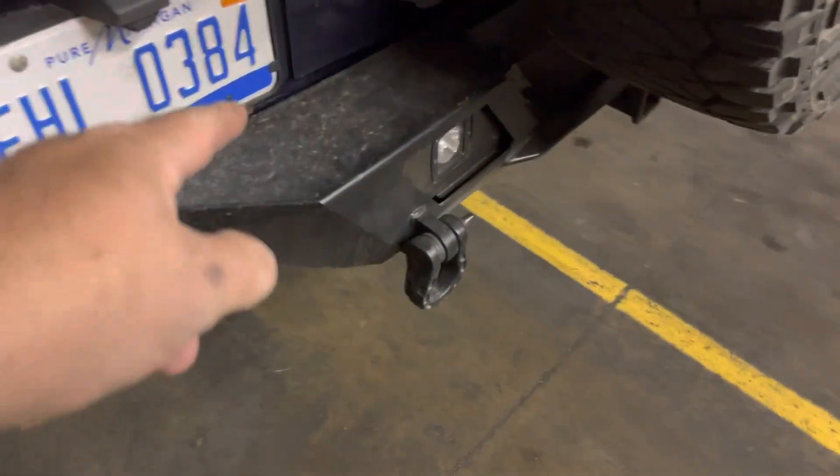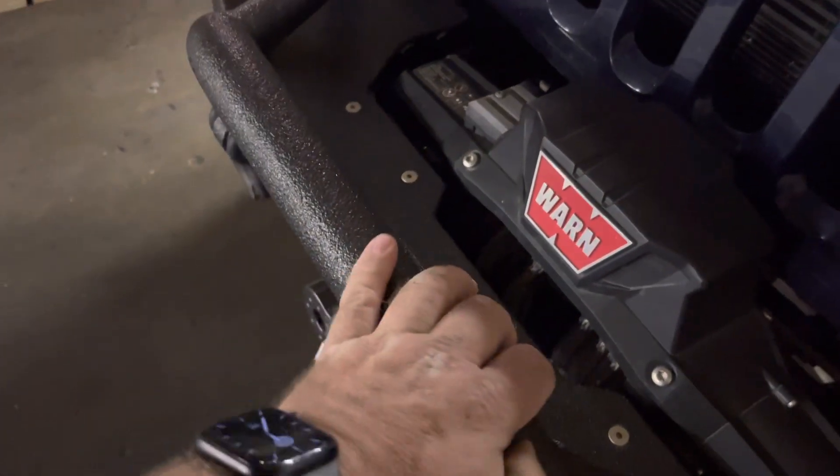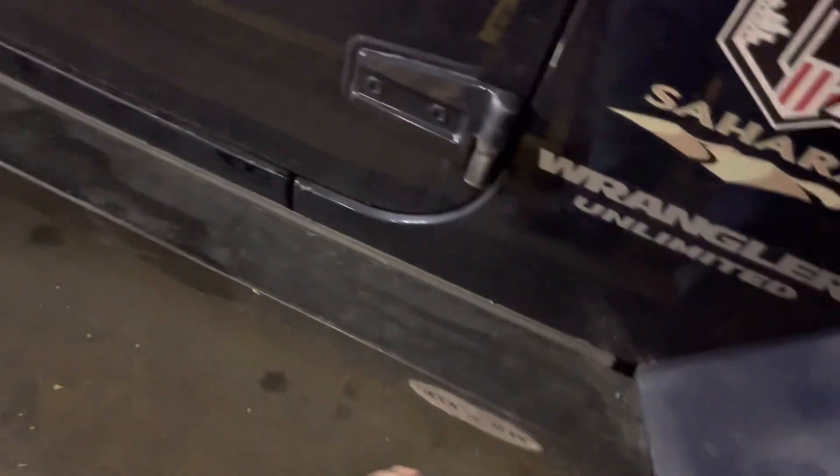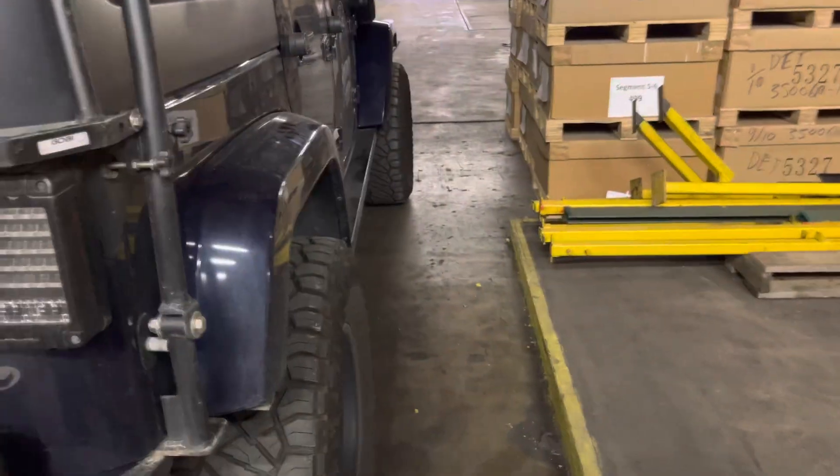Then I'm going to take my bumper off and have it Line-X'd — I'll spend the money on Line-X for that. The difference between Raptor Coat and Line-X is almost 90 mils of thickness and toughness. My bumper has had Line-X on it for almost a year and it looks like the day it came out — it's been bashed into stuff, smacked into rocks, and there's no damage whatsoever. So Line-X goes on the rear bumper. For the step sliders, I'd rather Raptor line them first, and if they get scratched I can just recoat.